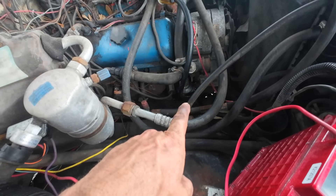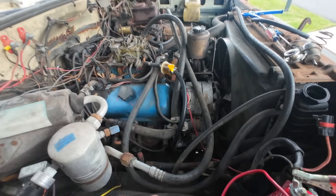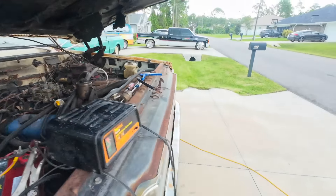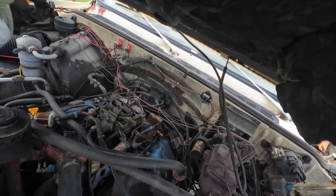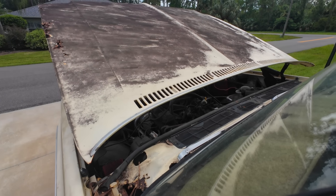And I'm going to say it again — hopefully we'll take this thing around the block. Got a new fuel pump in, got a new fuel line run as well up to the carburetor. We just backfilled the fuel line down to the fuel pump. Let's go ahead and put some fuel in here — you can kind of see the fuel filter in there.